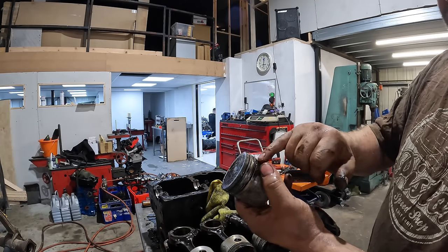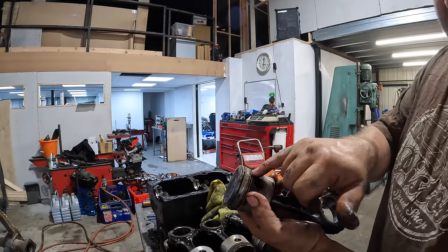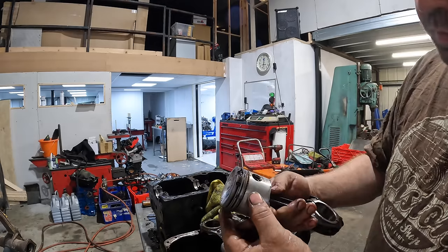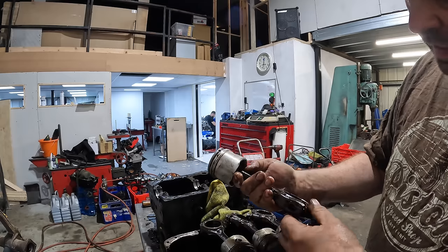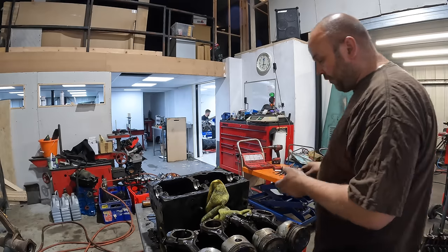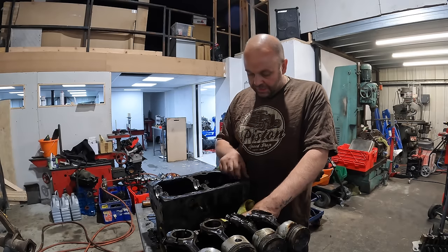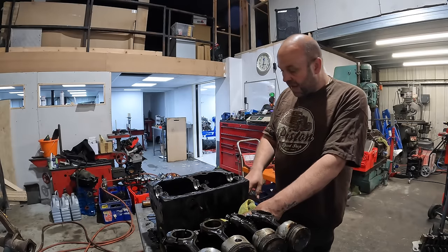The actual oil rail - this is a three-piece ring with two rails and the oil control in the middle - the rails are worn down quite a lot on that piston too. There's a lot of swarf in the bottom of the sump, so we're going to have to clean that out before it goes into the acid. The next job is to get rid of all the gaskets left on the engine because it's all siliconed up, remove the core plugs, and remove the oil gallery bungs.